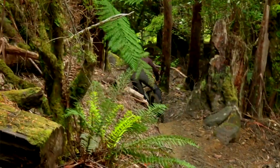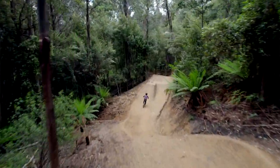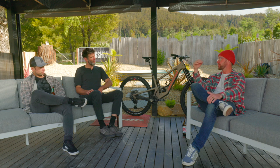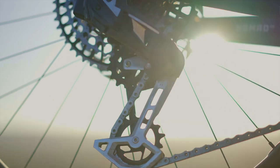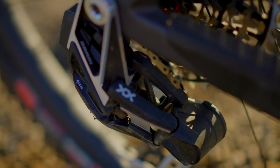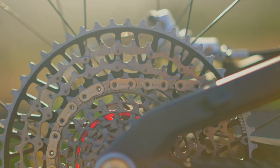There's no one detail that got us here — there are tons of little tweaks that get us to the finish line. Shifting under load is going to be a huge advantage on e-bikes. Two out of the three options we'll provide are e-bike rated: the XO group in front of us right now is totally fine on an e-bike, and the XX group — a tier above — is also fine on an e-bike. It's the XX SL group that we don't recommend for powered systems.